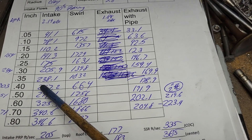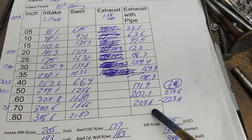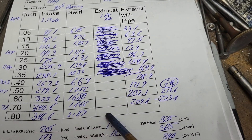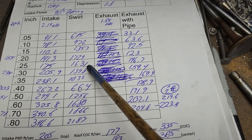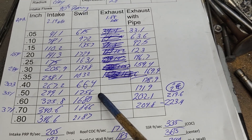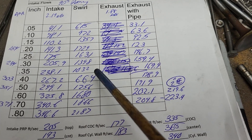The first thing I'm going to do is try to improve these numbers, and I'm sure I'll do the exhaust as well, but I'm only doing an intake manifold for the man. As far as our swirl numbers — really not terrible. Right at 600 lift, 1680 is actually quite good; I would like that number.